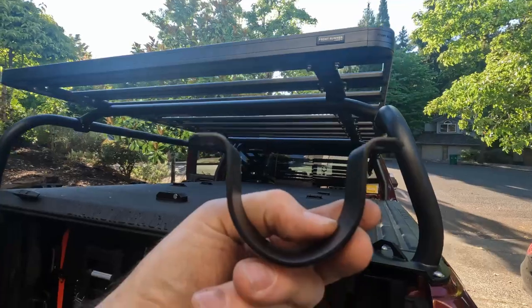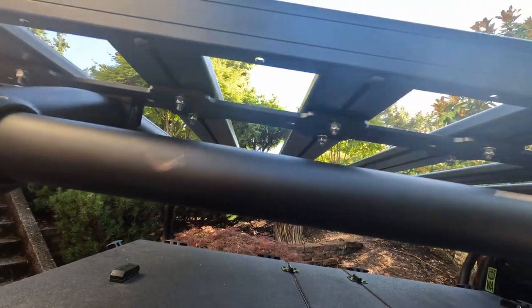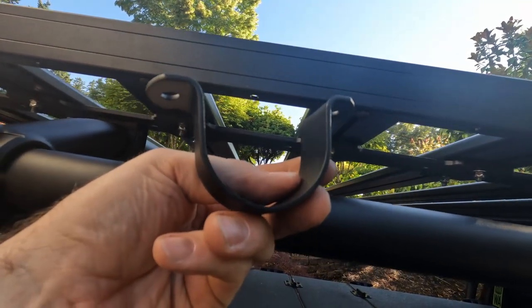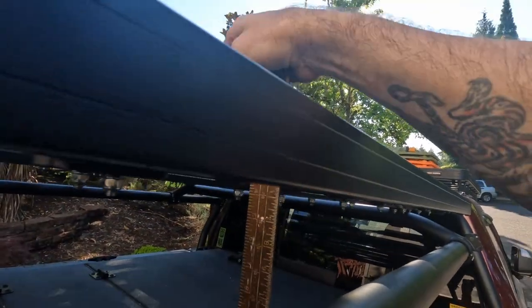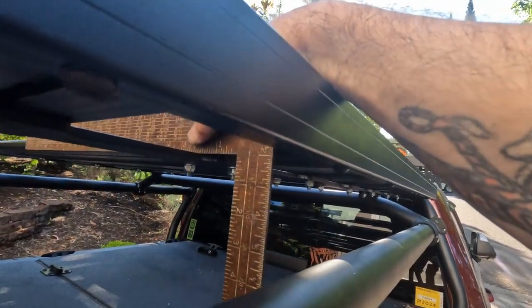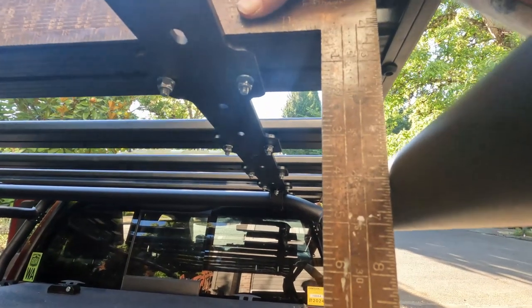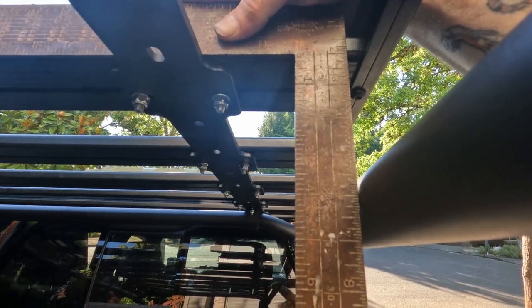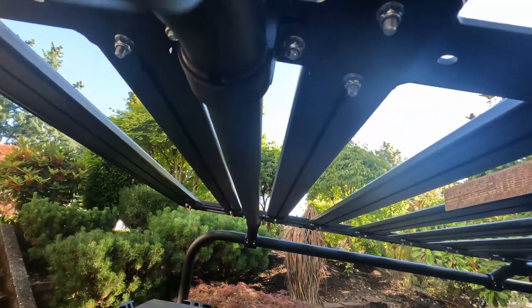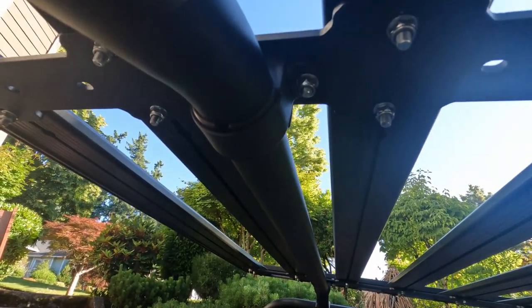We'll attach the brackets to the bottom, get them in place, and make fine-tuning adjustments front to back with the crossbars. There's also a slot in these screws for a little adjustment room once the brackets are in to secure the rack. For left-right centering, I used a square on one of the brackets, moved it over until it touched the inside of the bar, then measured the gap up top — roughly a half inch on both sides — to center the rack.